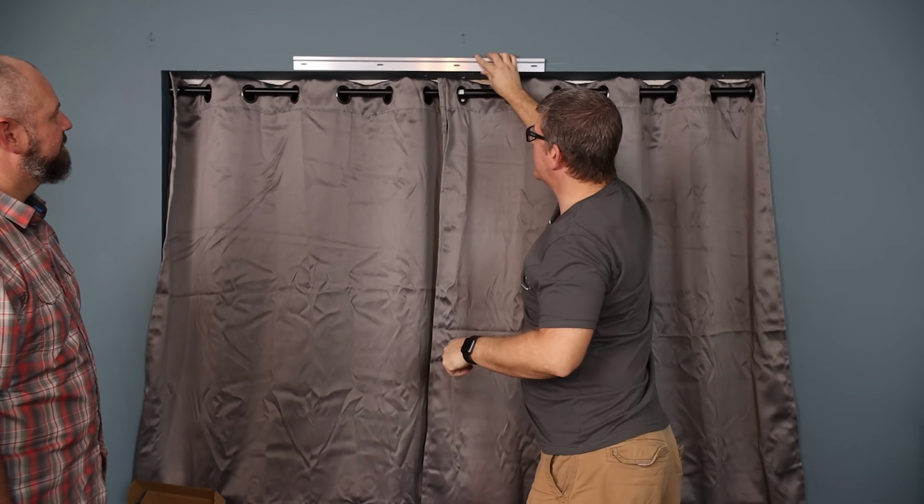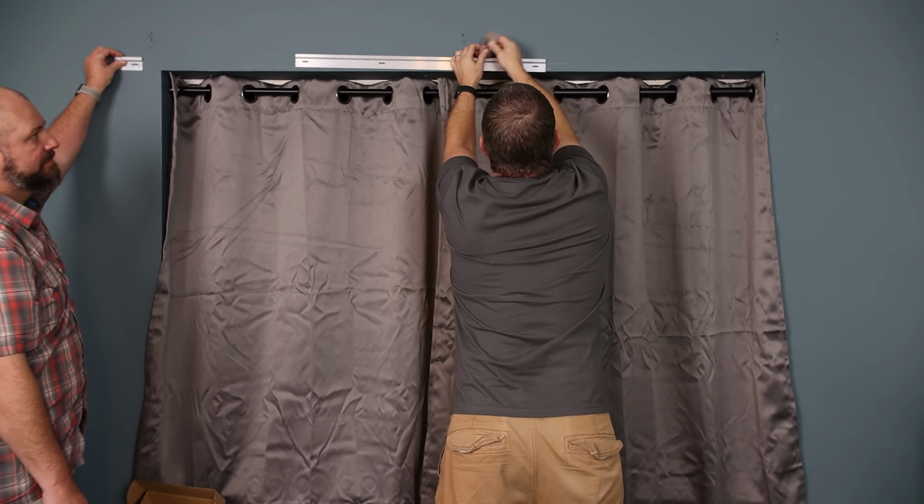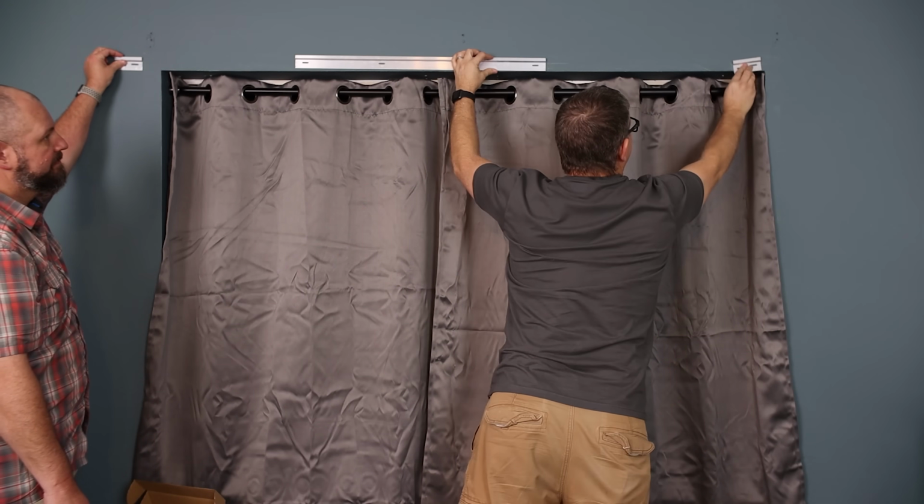The other thing is where the mounting bracket mounted, we had to go right above the windowsill, so we were limited on how low we could mount it. When we mounted that, that determined where the screen was going to be. Right. And where the mount goes is actually about 4 or maybe 5 inches below the actual top of that Nano Edge. On the back of the frame, it's about 5 inches down, so you have to account for that when you're mounting, to know where the mount will actually place it. That's one of the things we had talked about before. It would have been nice to have a little more information on placement.